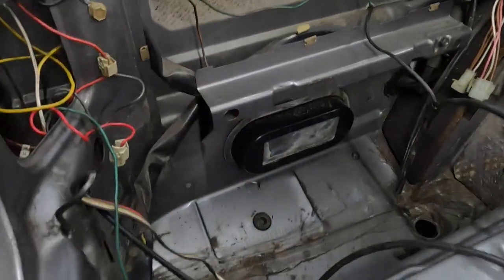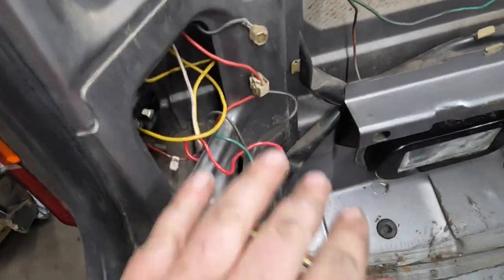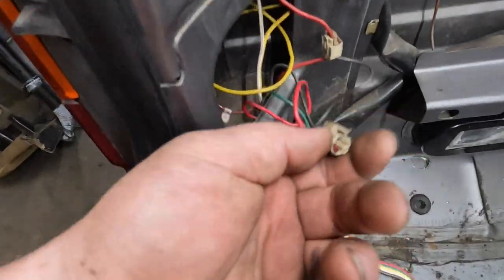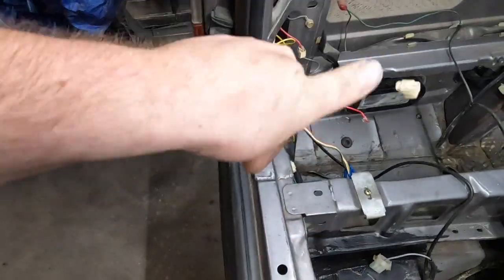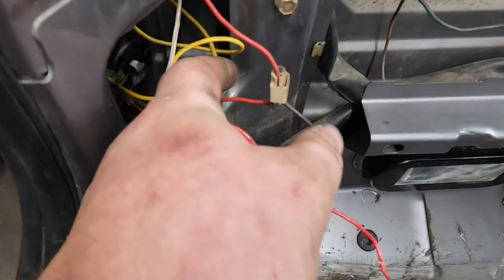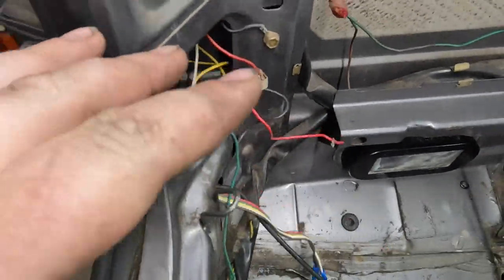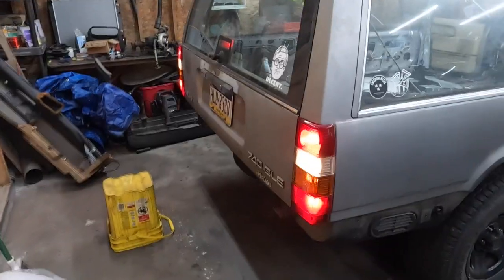I have been procrastinating on these taillights because someone tried to hack in a trailer hitch plug at some point and used all these little blade-type splices. If you put these in an automobile, especially somewhere they're going to get wet, you should be beaten with a bowling trophy and left bleeding in the moonlight — that's about the worst thing you can do to your poor wires. Don't use those — just a very convenient place for corrosion to live. It's going to start with cutting all that junk out and then see if some things start working. And finally, we got some nice Christmas tree action going on back here. Even the plate light's working — it was just a matter of some crusty connections at the bulb holders.